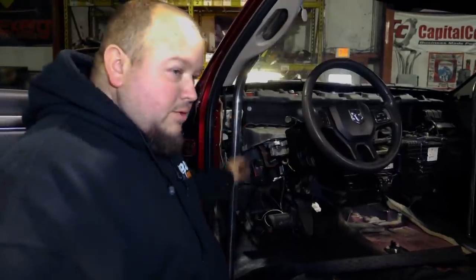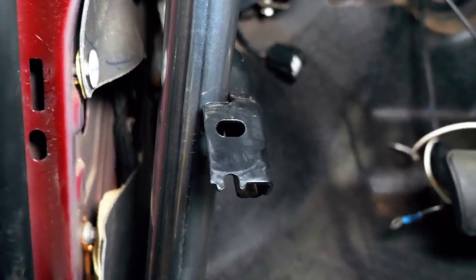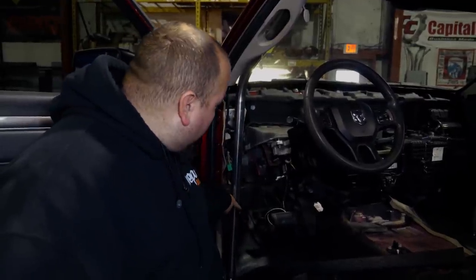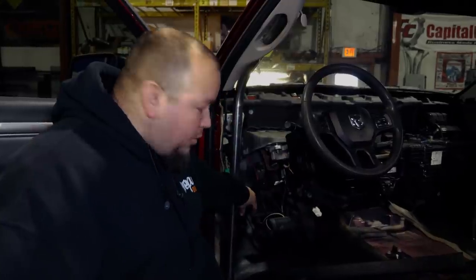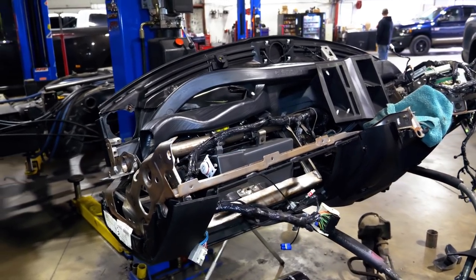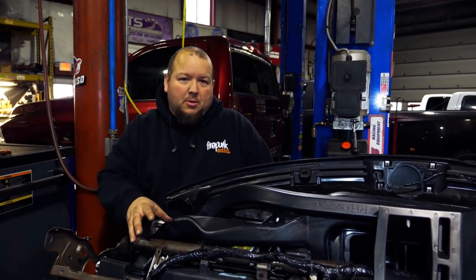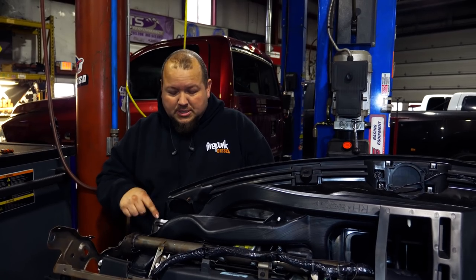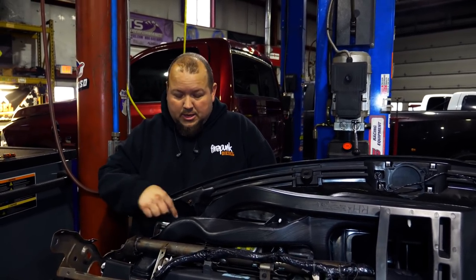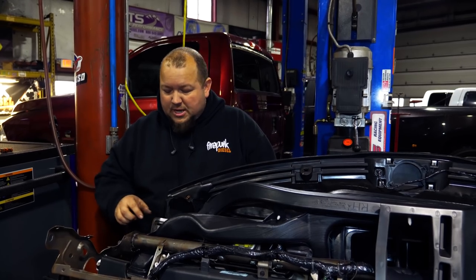One clearance issue we're fighting is the e-brake. The pipe is tucked up real tight against it and he couldn't push the pedal, so we're going to cut the tab off and move the foot pedal over a bit so it can clear the bar and he can still have an e-brake — a pretty simple fix. Working on making clearance for the bars going through the dash, we're keeping the air box, so pretty much the only functionality we'll lose is the ducts going to the outside vents will get cut back — air will blow over to that corner but not directly out the vent. A small sacrifice.